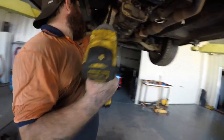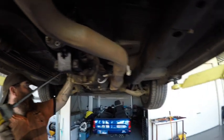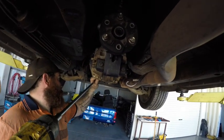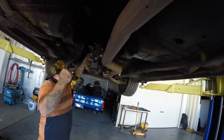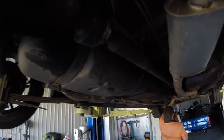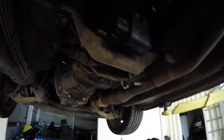Alloy to alloy. Go around and do the gearbox to bell housing bolts - 8 of them, 13mm. 15mm there we go. Then yeah we'll go back through - put the crossmember bolt on, put the tailshaft back in, uni-joint, that's it. Bleed the clutch and hook the wiring up, call it a day. Tailshaft bolts are back in. The crossmember in - Bizzo is putting some Dexron 3 oil in, fill her up.